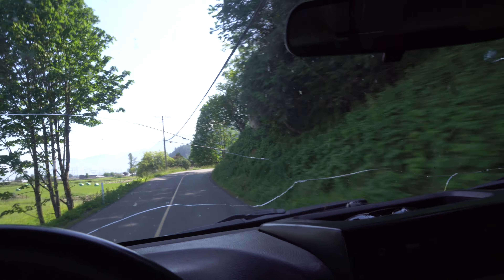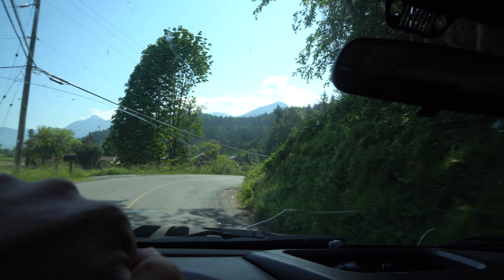If you've been following the build, one of the things I did is shove in the SRT torque converter, and I kind of wish I wouldn't have. The reason is I was driving along, got up in speed, and this thing shifted one more time at 140 kilometers an hour — that's way too tall for this build. With a two-door Jeep, if you need to take an emergency turn at that speed you're going to roll it. So if you're thinking should you get a different torque converter than the stock 3.6, no — just stick with it.